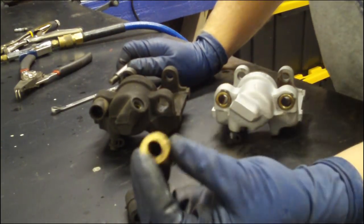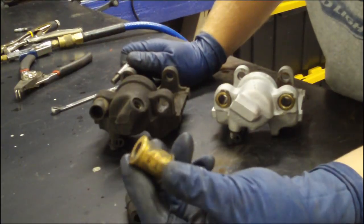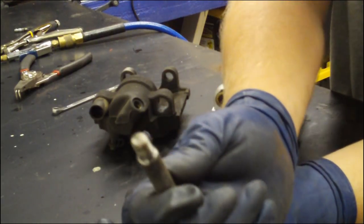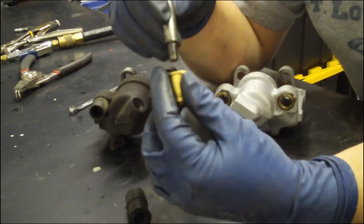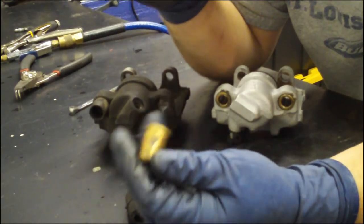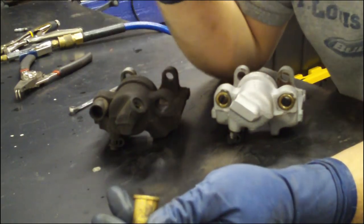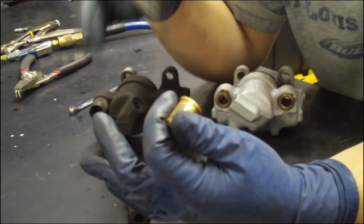To maintain these, every time you change out your brakes, every time you change your pads, every time you remove the caliper, you need to clean this out really well — q-tip or something — and then you need to grease it with high temperature brake grease. If you don't, if you leave it and let it corrode and build up gunk, you could very well find yourself going along the highway and suddenly smelling something terrible — one of your brake calipers dragging the pads on the rotor as you drive.